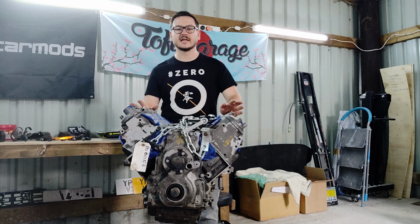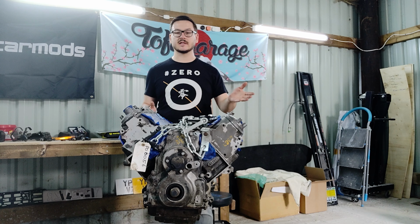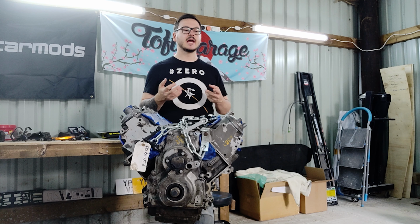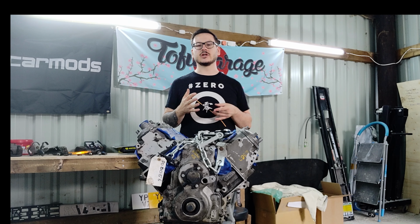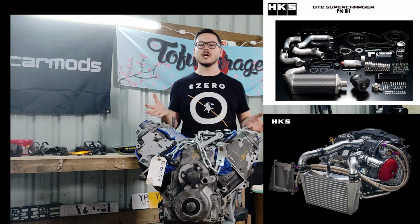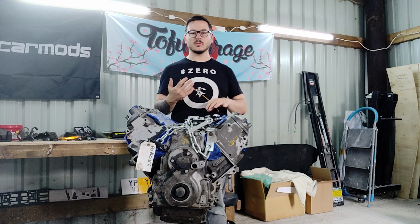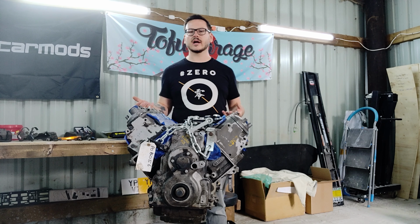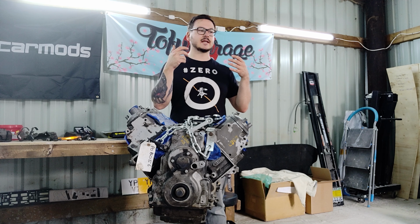I wanted to hit a number in the 86. I'd say around 350, if not more, which is absolutely doable on the FA20 engine that's in the GT86, but it can take quite a bit of money to get there, and the engines themselves aren't really geared up for any kind of high boost application. The ceiling of boost that you can really run, be it supercharger, turbocharger or such, is really around 7, 8 or 9 PSI without having to open up the engine, build the engine, and likely lower the compression a little bit. Without that kind of high-ish boost of 18, 20, whatever PSI, it wasn't really what I wanted. Not to mention after that, then there's the worry of, is the gearbox strong enough, and is the engine itself strong enough?